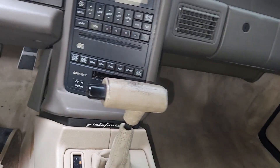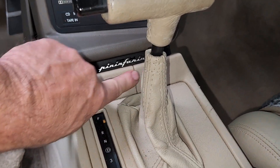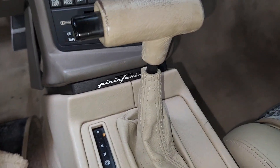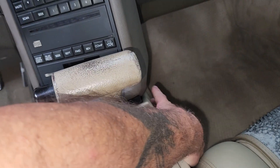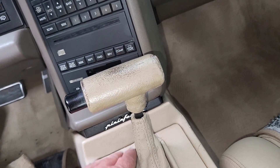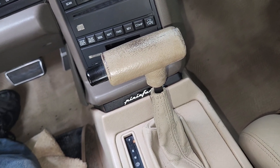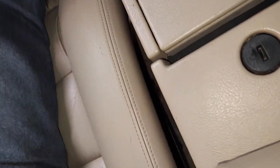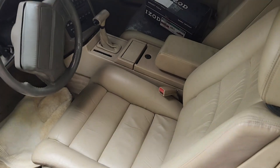If it's broken across the front, that's a difficult repair. There are two little hooks underneath which I'll show you on the one I have out — it just slides up in there. But basically you're going to take the shifter out, remove those two screws, remove the three 10 millimeter nuts in the back, then lift it up, slide it back, and take it out.